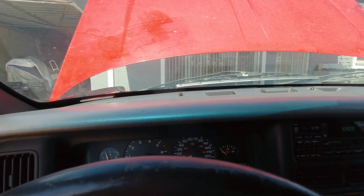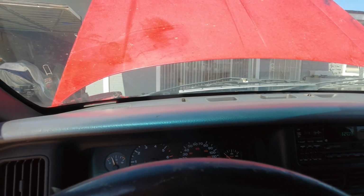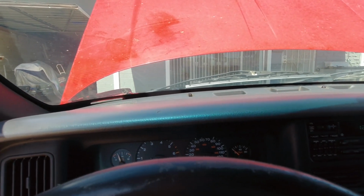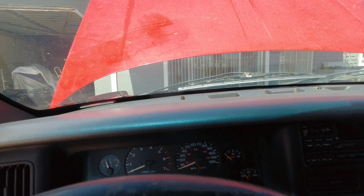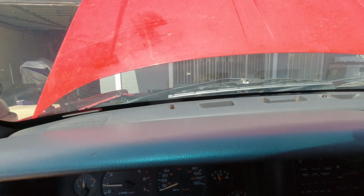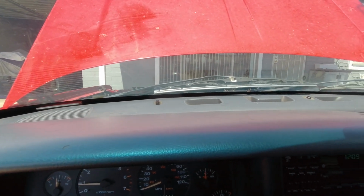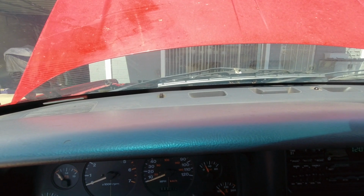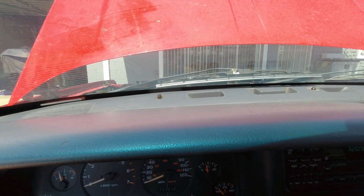I've noticed one thing. LED headlights are very, very dim at, you know, 12, 12.2 volts. They really need the full power of the alternator to be bright. You see that? You see how much brighter they got? Can you see the reflection in the window there? Well, look at it with the key off. And now look at it with the key on, with the engine running.